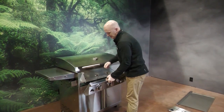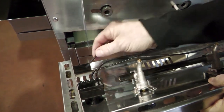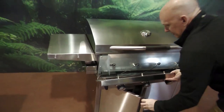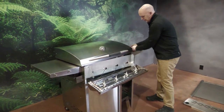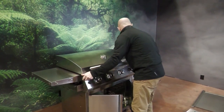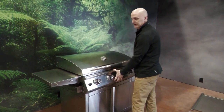Put the panel back in place and hook up your four igniters again. You can open the doors to rest the panel while you secure the front heat shield. Then reverse your actions by putting this up, sliding it back on, and securing it with two screws on each side.